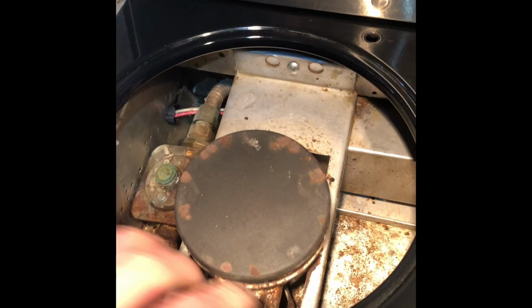These little pins on the front of the drip pan, they go into these holes here near the front of the stove, one on the left, one on the right, to lock it in. So we first put in the tab in the back, and then the two pins in the front settle down and lock in.